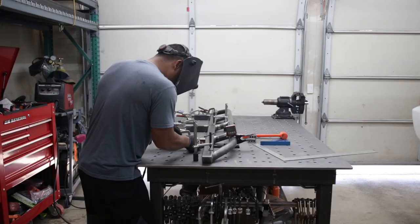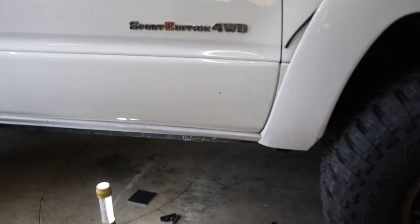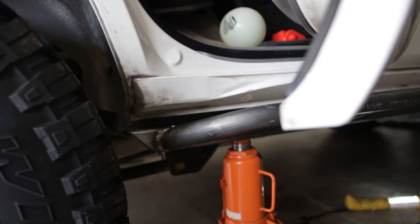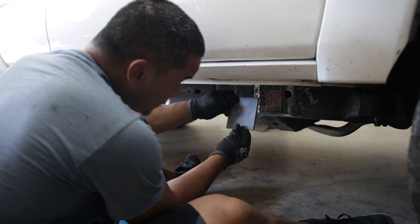Where you place the sliders is also important — you want to make sure they are clear and away from any brake cables or cable lines. For visual reference, I drew a quick template on the frame to show where my backing plate would need to be and where I'd need to grind off the factory coating for a clean weld up. I probably should have mentioned this earlier, but make sure you check the sliders to clear your doors before you do all that welding.